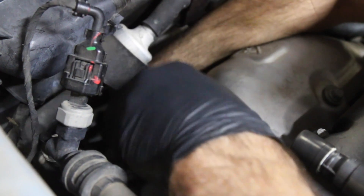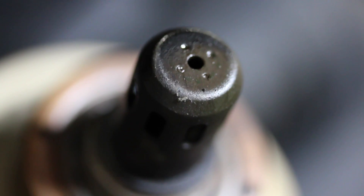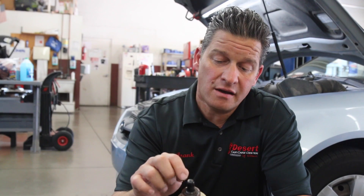Let's take a look at the oxygen sensor. O2 sensor sockets come in different sizes — we've got the right socket on and we're slowly ratcheting it out by hand. On some occasions those oxygen sensors can be pretty seized into the exhaust due to heat; you may need a torch, but we didn't have to do that here. Once we got the O2 sensor out, you can easily see on the probing side that it's contaminated — lots of black, carbon-rich, fuel-fouled buildup.